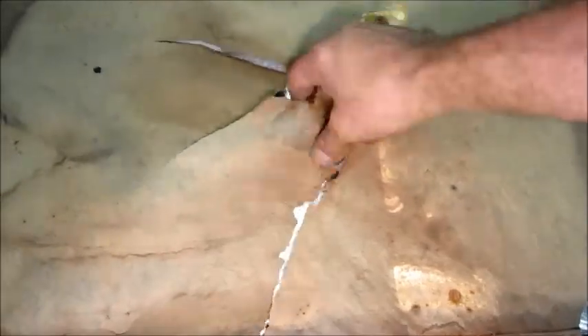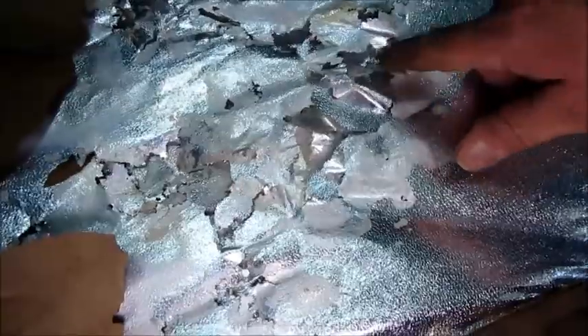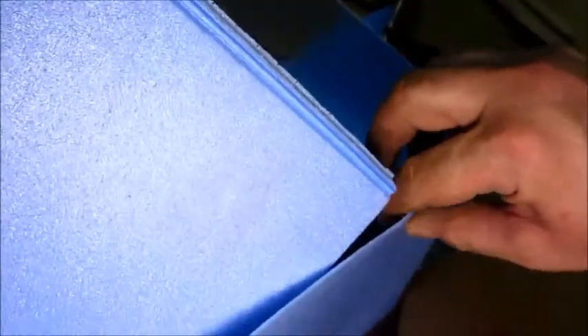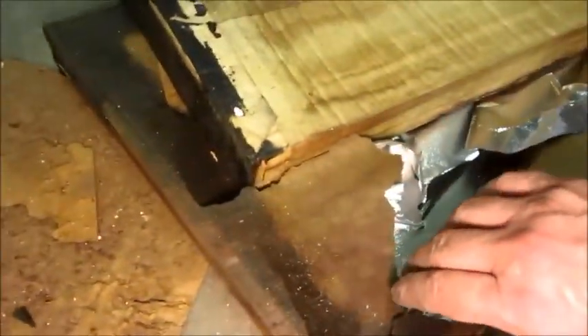Here's another one of those panels — it's still kind of intact, but you can see how deteriorated it is. Open it up and it's already falling apart. So there's just no way around redoing the insulation in this one. This thin foam board — two layers of that make up for this material. I got that in the sides, and then I got the styrofoam board and made a sandwich of several layers of it to replace these panels.